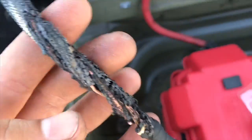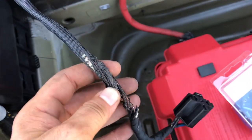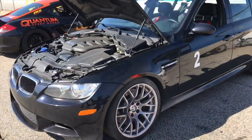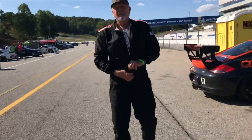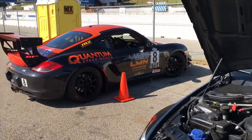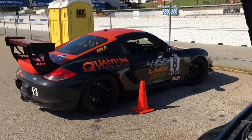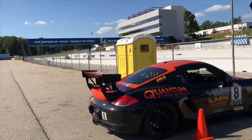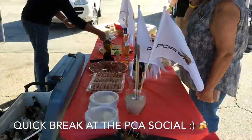There's another E90 – an E90 M3 – okay, you need it by tomorrow morning. What I'll do is try to dig into it, get the fan out, put a battery to it, and see if the fan fires up. If it works, it's not the fan; if it doesn't, I'll try to go get one at a store and replace it. That switch is supposed to go directly to the fan. This looks awesome – you're going to be a busy guy.